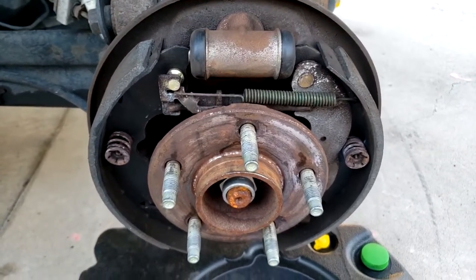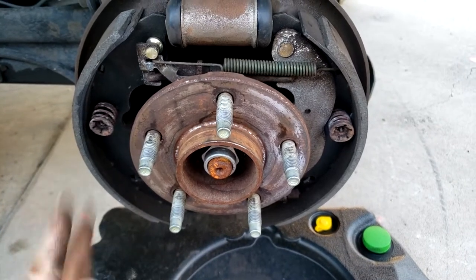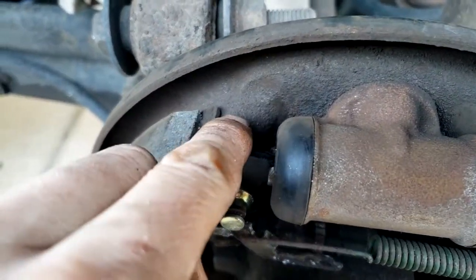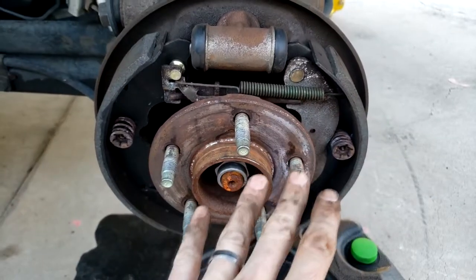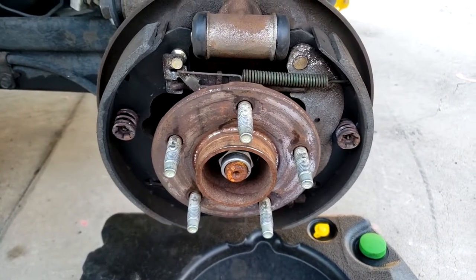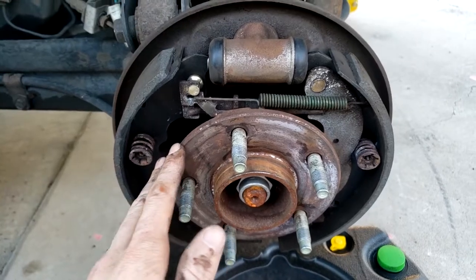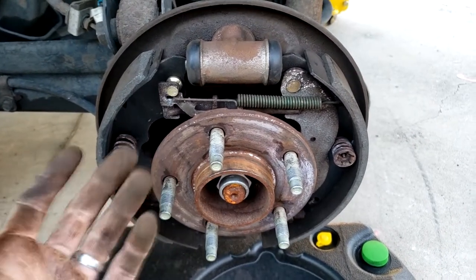One thing to talk about quickly is brake grease or brake lube. What it does is prevent the loud squealing noise when you apply the brakes — that's really all it does. People tend to grease the pins where the shoe contacts the backing plate — up here and at the bottom on both sides. Do not use anti-seize — it is the wrong component for this. Use proper brake lube; they cost the same if not less. Anti-seize can actually cause problems even with ABS components. It's optional — if you don't have a squeal maybe you don't need it — but if you have an annoying squeak when braking, that's what it's used for.